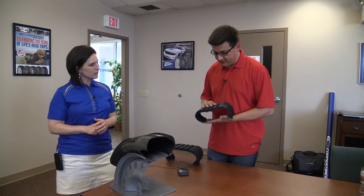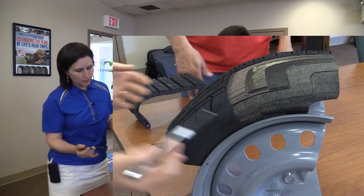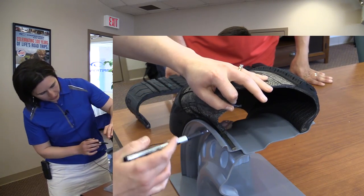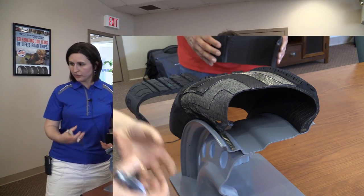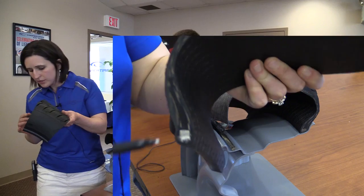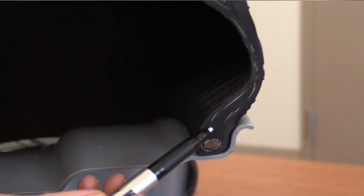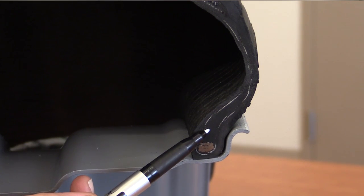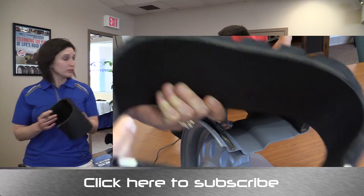In broader generalities, what in the tire resists the tire from moving side to side while it's on the wheel and moving down the road? The polyester body plies give you some of that — some stiffness in the sidewall. But the other component I didn't touch on is known as your bead filler. You've got this bundle of steel wires that hold the tire tightly to the rim after the tire's been mounted. On top of that bead is a triangular-shaped piece of rubber — usually a very stiff rubber compound — that gives you the ability to translate forces from your steering wheel through to the road. That stiff piece of rubber gives you that lateral movement.